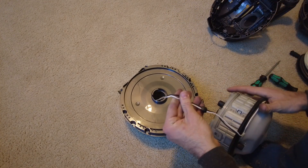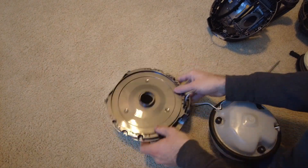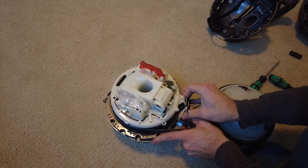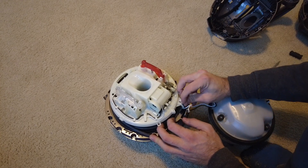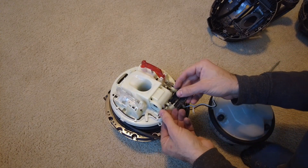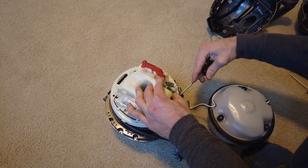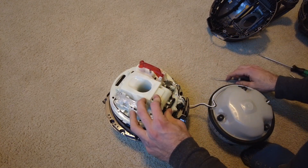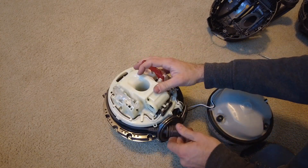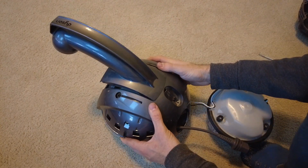Assembly is the reverse of disassembly. First, put the motor wiring back through the new filter. Now reattach the cord winder — I will concede that's pretty elegant — and re-route the wires. Get the little terminal case and make sure you get all the wire routing just right, otherwise it could cause interference with closing up the clamshell again. Go ahead and clip back on this cable guide, then put the top half of the clamshell back on.